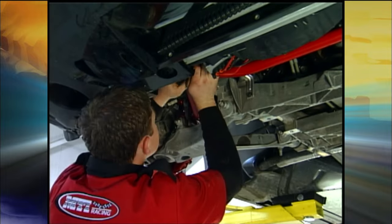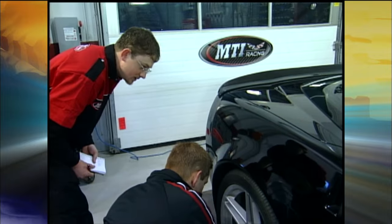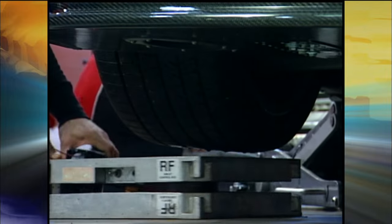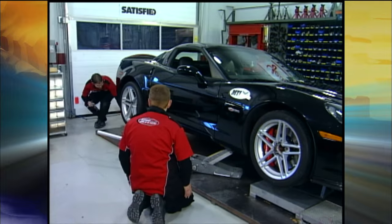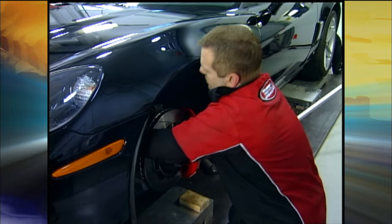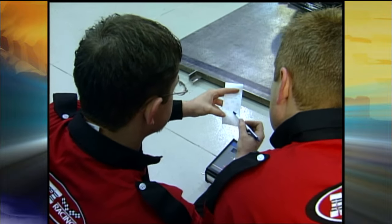The sway bars are at a higher rate than stock, but not so rigid they cause a horrible ride on the street — they're very tolerable. After a complete suspension makeover like this, the first thing we do at MTI Racing is pull the car onto a nice flat surface and baseline everything. We measure corner weights using corner weight pads — it measures the force exerted at each of the four corners. Getting the setup proper is absolutely critical. We've rechecked all corner weights, re-verified all ride heights, and are making subtle adjustments to get the car dead on perfect.